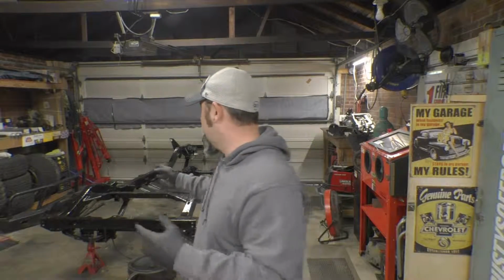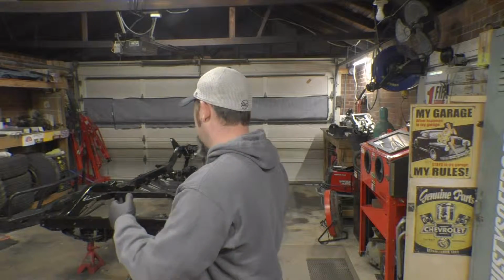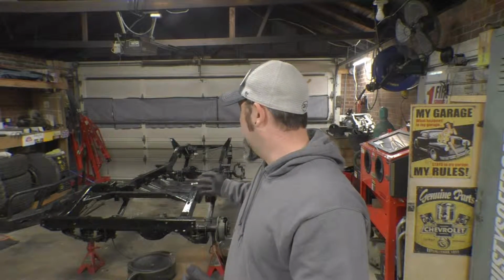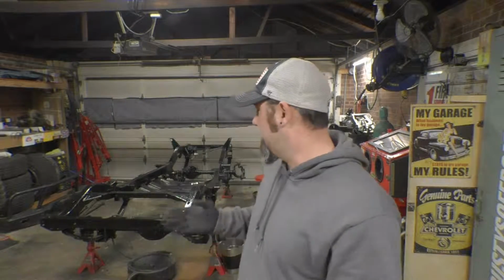All right, guys, so I've got both sides of the Jeep. I've got the brakes themselves drying off. I'm gonna go ahead and pop the diff cover and drain the differential fluid and start inspecting it. And then if you've never done this before, I guess this can serve as a quick tutorial on how to remove a C-clip axle as well.